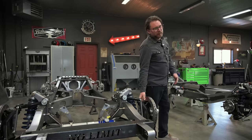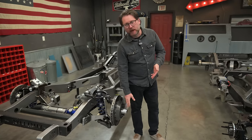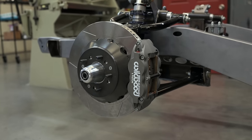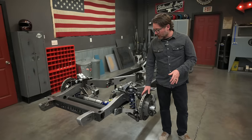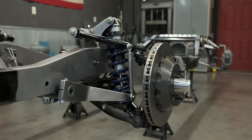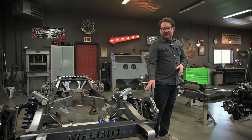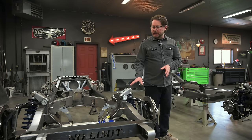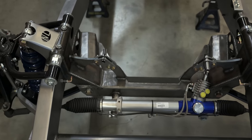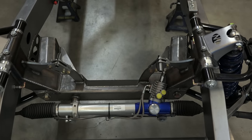Both these things will have our battery boxes mounted to the frames. This one has the ZG spindle that you've always seen — it's a standard pin-style spindle with traditional packable bearings inside of it. This is a great spindle and also a much lower cost spindle — tried and true. We actually put bearing spacers that preload inside there to make this a super strong spindle. It's nice and tall, there's tons of camber gain. This one's also got the Flaming River rack that we've been using now for probably three or four years with zero issues — it's a nice heavy-duty rack.